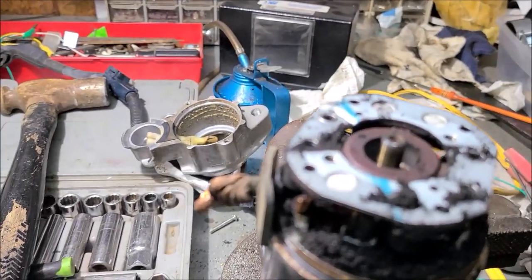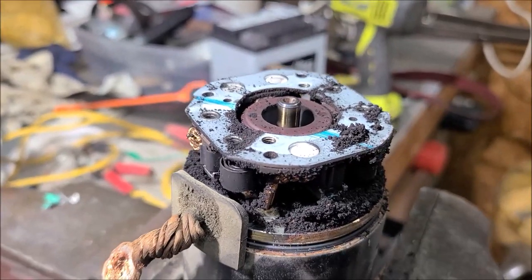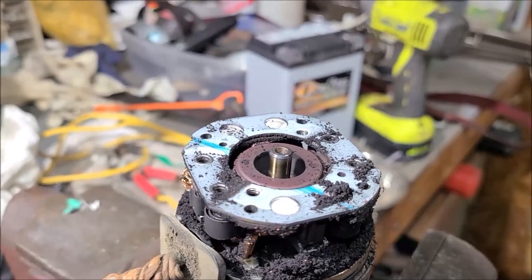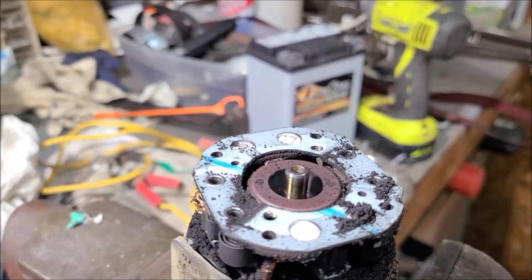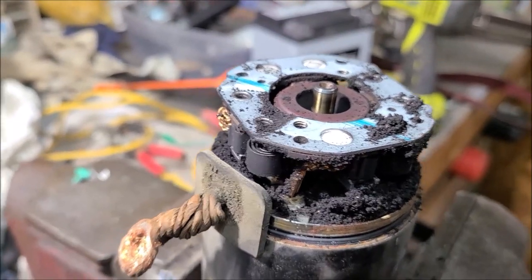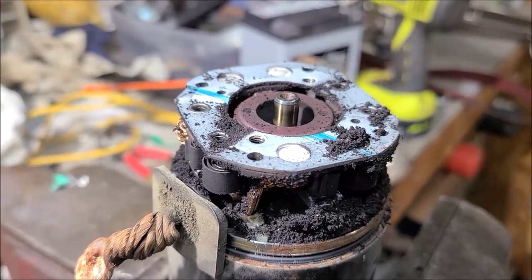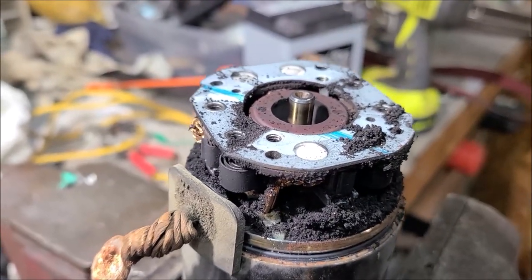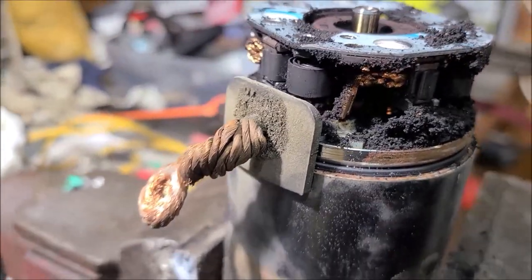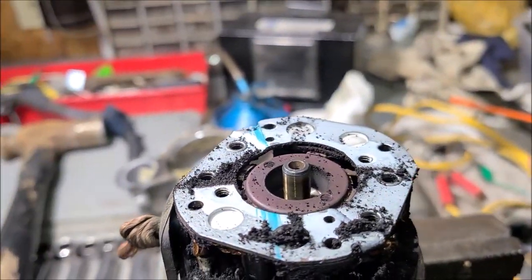That's shocking. Now, something I've always done throughout my life with any vehicle I've had: when you get about 90,000 miles, that's when I go ahead and pull the starter off. I did it on my Nissan, my Corvette, and that little Chevy Spectrum Sport we have. When you hit about 90,000, I'd pull the starter off, put new brushes in it, rebuild it, and put it back on. By doing that, I've never got stranded because of a starter issue. But this one, man, at 75,000, it don't look so good at all.